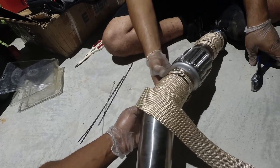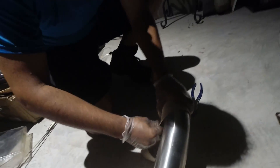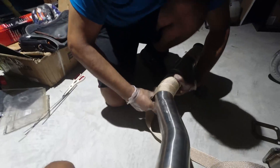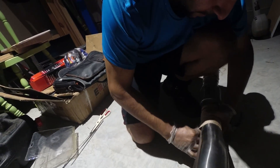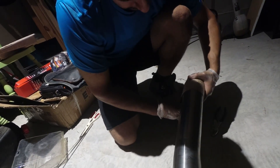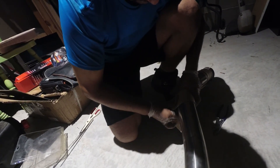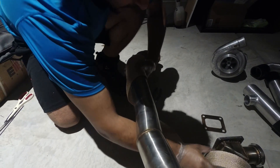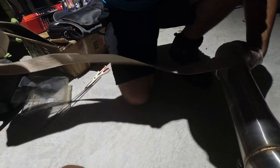You're going to have to really yank on it. Now that's pretty taut — it's not going anywhere. You can wrap it a little bit easier now. There are two ways of doing this: you can just keep twisting the pipe itself and have someone at the other end hold it for you, and just keep going. Working around bends is going to be a little more difficult — you have to adjust for the bend. Just keep playing with it and you'll eventually get to the end. One thing you'll realize as you're twisting is that the wrap is going to get warped, so you'll need to twist it accordingly so it doesn't bunch up on itself.